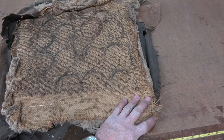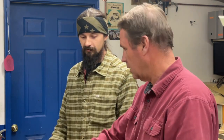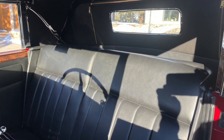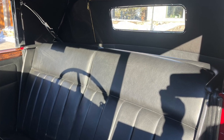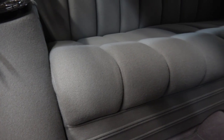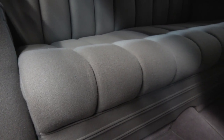Are you going to build it back exactly like this? Not necessarily exactly. With modern materials, we'll use foam because that's fairly commonplace. But it depends on the seat — I might use some cotton, some foam, some polyester batting, and so on. One thing I really don't like about guys doing upholstery today is if they just use foam, these pleats look square as hell — you get a flat little pancake. I like a nice curve to the pleat. If you use cotton and foam, you get the stiffness and rigidity I like. I don't like wallowing down in the seat — I like them nice and hard, with a nice little crest.